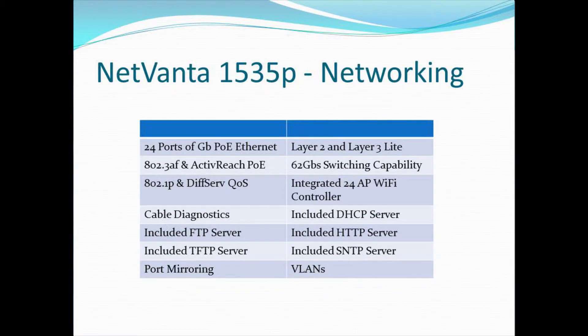The system also includes a full DHCP server, which is very useful. If you have any IP devices such as cameras or telephones that need DHCP options to provide configuration information, you'll need a DHCP server capable of doing that. If you have an existing DHCP server that supports options, you don't need this facility. However, if you don't have full access to that server or it's simpler and doesn't provide full options, you can use this to give phones the information they need to boot — including Polycom, Cisco, ShoreTel, Avaya, AdTran phones, and many other manufacturers.